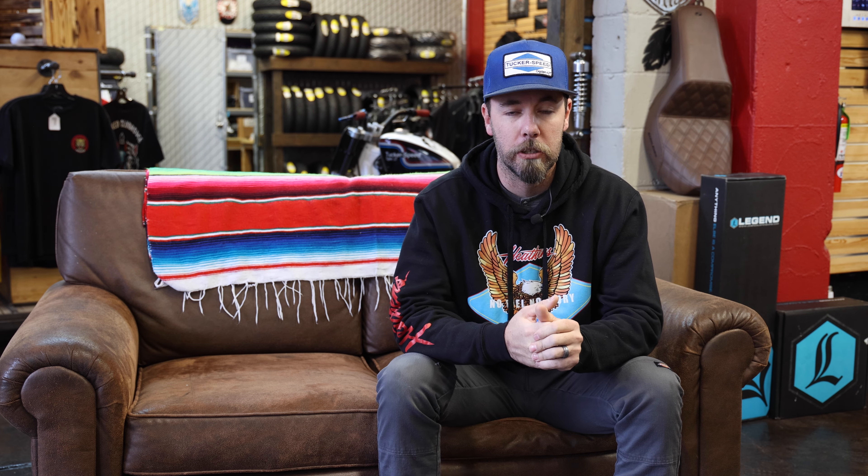One of the modifications I wanted to do after Salt Lake was to raise that up. I had to pull the swing arm out and machine away some material on the bottom side so it would swing down lower. Rather than changing shocks — I was super happy with the Legends I had on the rear — I machined a two-inch block that mounted to the top of my swing arm, raising my rear shock mount, giving me an overall 16-inch setup in the rear.